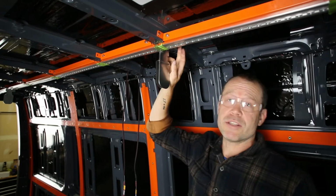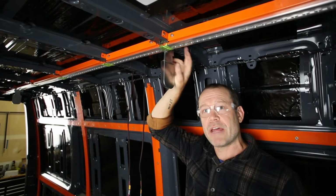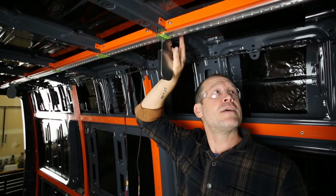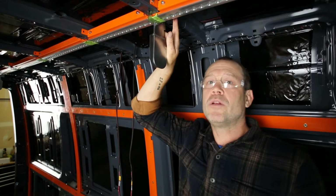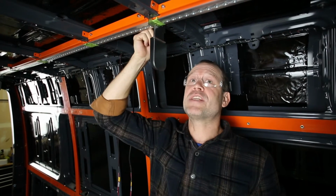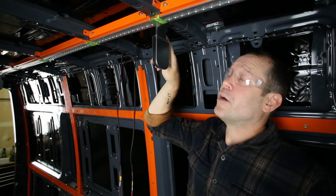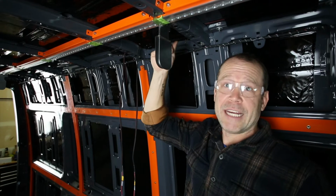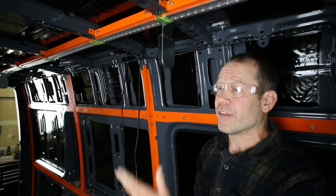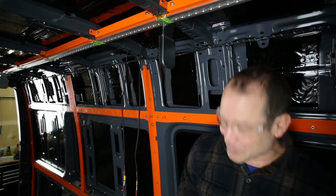And this obviously is the process if you have the tools to set the thick 1/4-inch stainless steel rivets. If you don't have this tool, it's a simple punch hole here, punch hole on the other side, slip your through bolt through and tighten it. We're not going to demonstrate that. We figure if you're capable of doing this, you're capable of setting a through bolt.